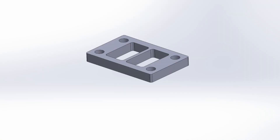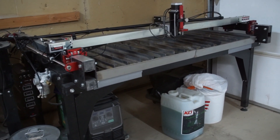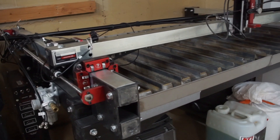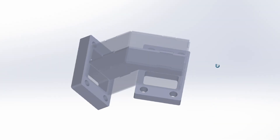What the mount does is take the turbo and clock it 135 degrees off the side of the engine. The way I was going to fabricate this was to use a bunch of custom plates and buy a couple of T3 turbo flanges and weld those to each end, so there would be no machining involved. Luckily I have a secret weapon — I recently purchased a CNC plasma table, and this is the perfect project to put it to use. A stock Cummins turbo, the HX35, comes as a twin-scroller divided setup. It has a divider in the center that separates the exhaust pulses from each cylinder so the turbo is always getting pulses to spin it up. When I made this mount, I wanted to keep that center divider plate to preserve the twin scroll design, and I was really happy I was able to do that.